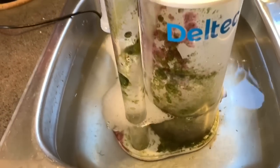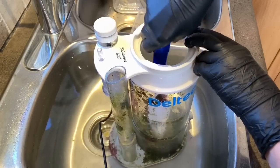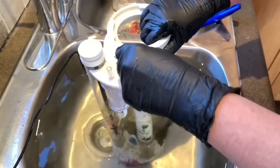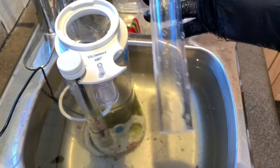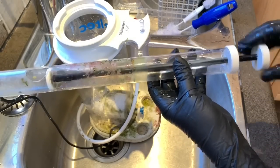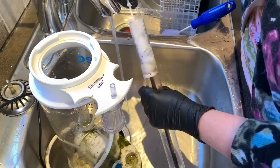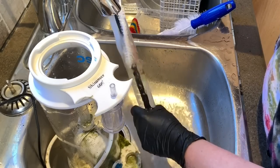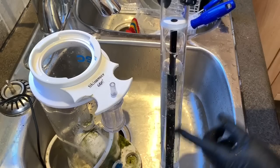Chad has been working hard for roughly seven months at this point. Running the skimmer in vinegar and water for a little while loosened a lot of the stuff that had built up. I decided to get as much cleaned up as I could while I still had the vinegar and water here, then let it drain away and take everything else apart. The water level tube was easy to clean with a brush and came out nice and clean. The water level adjustment tube, however, was a different story — there was some stuff in the middle. I tried unscrewing the entire black rod but it only went so far, so I decided to approach it from either end. I cleaned out the bottom end first, then took the tube and screwed the stopper down past the intake hole so I could get a really small brush inside — this worked pretty well. I was unable to get everything, so I poured vinegar into it and set it aside to soak.